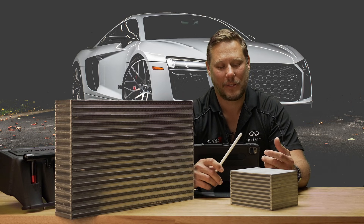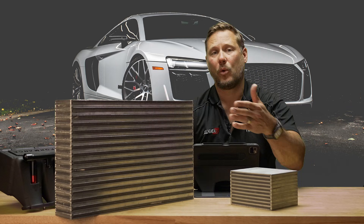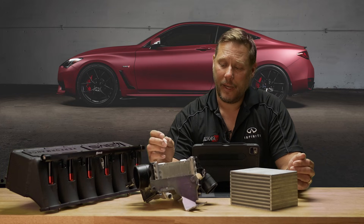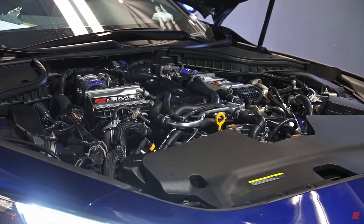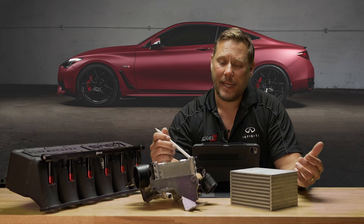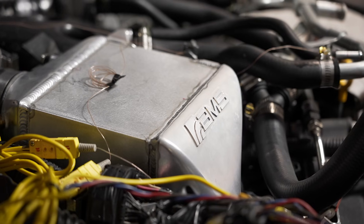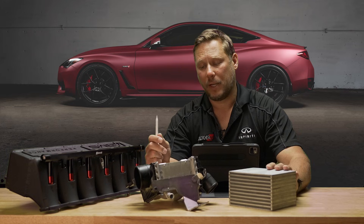Running an ice tank with ice is a pretty huge benefit. To get 25% more effectiveness out of an air-to-air intercooler, you have to grow that thing in some dimension. A 25% delta on an air-to-air is quite a bit bigger than a 25% delta on an air-to-water. Here's an Infiniti intercooler for the Q50/Q60. The OEM makes things a certain way — they have a performance goal in mind, but cost is a huge factor. Stampings and provisions with the end tanks limit the size they can make it. We take advantage of that. These end tanks are actually crimped on, so they need a certain size header. That kind of eats up some core size. We're not doing that — we're making our own end tanks, which are welded on. We have this height advantage already right away, plus we've grown this thing by quite a bit.